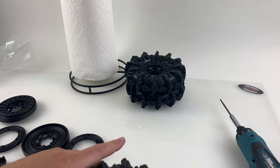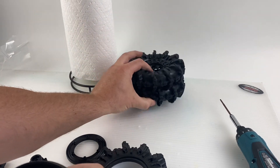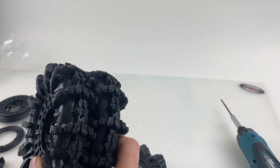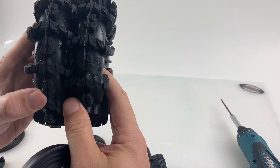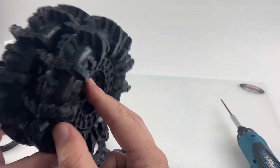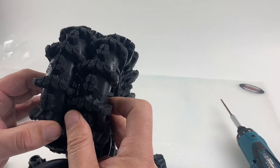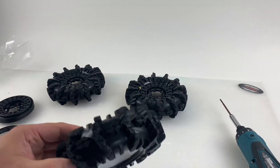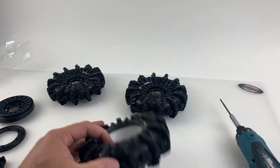First step — you can clean all this, but it's a beadlock. Windex on the inside makes it easy. I already have two tires built with the directionality already set. You can see the tread pattern has an arrow; I'm doing them forward. You can obviously flip them around if you want that dig pattern. Just as long as you build two lefts and rights, you're going to be happy. If you do three lefts, you're not going to be happy — trust me. This one's going to go on this side and I'm going to build the right side tire.